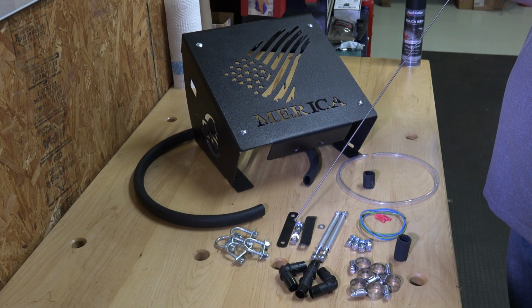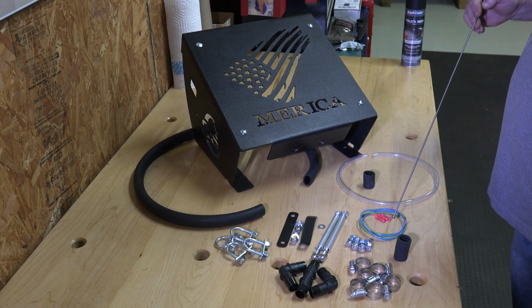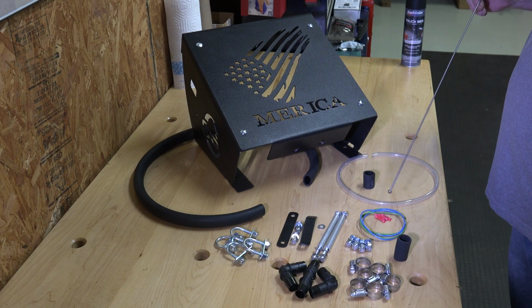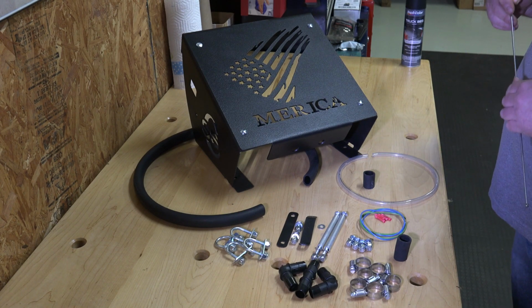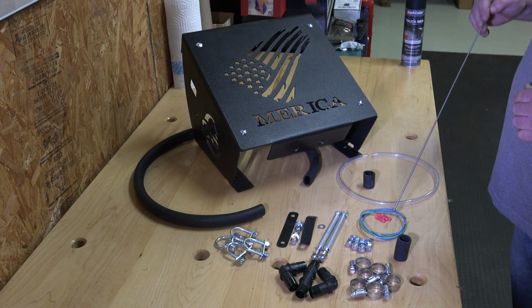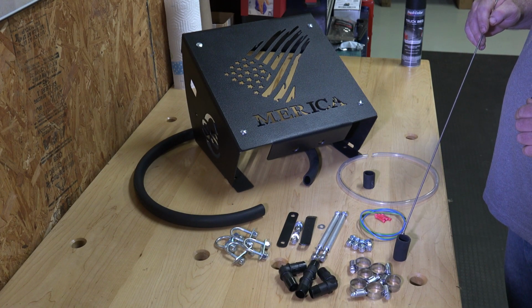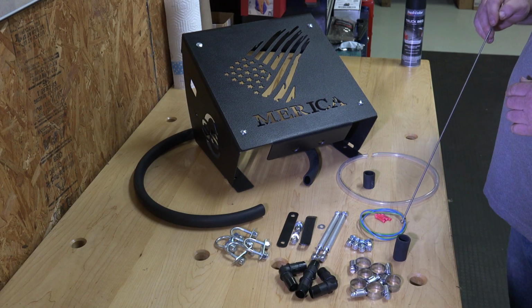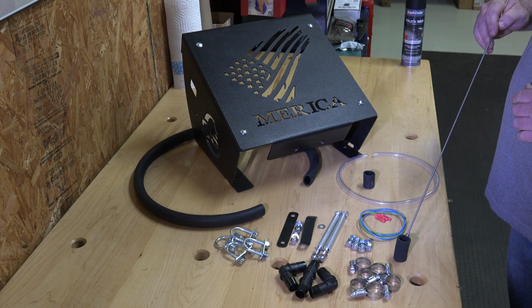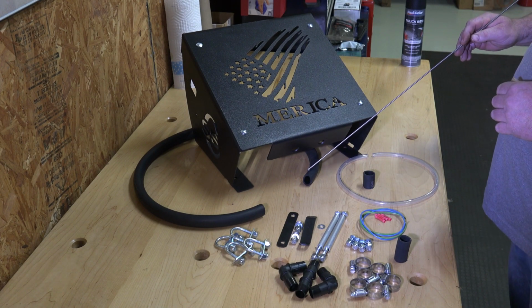These are going to allow you to relocate your coolant recovery bottle. The wires and the butt splices, you probably won't need them. Your wire is going to be long enough, but by chance it is not long enough, that's why these are supplied. Now this piece of hose right here is 2 inches long, and I'll explain that in a later clip, but this right here will come to you already cut 2 inches. You'll get about 46 inches of this hose.